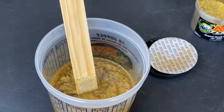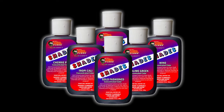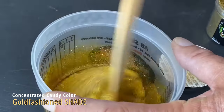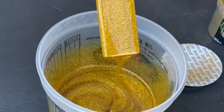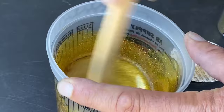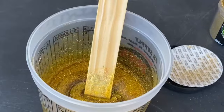After mixing it up, we pull the stick out and take a look — the amount of flake on that stick gives us an idea of how much flake we'll be putting on the base body. That looks like a pretty good amount. Next step is to use shades — dyes in small bottles that treat 24 to 28 ounces of clear or intercoat clear. We're adding some gold fashioned dye in shades to this mix. So now you've got pearl, flake, and candy all in this mix. Keep stirring that up good and we'll get it out on the base.